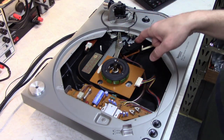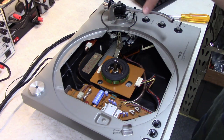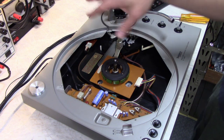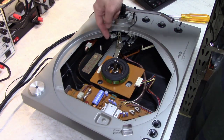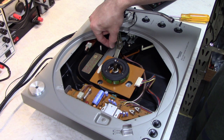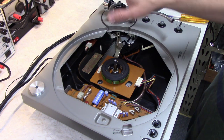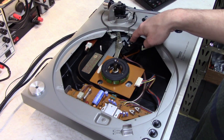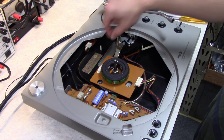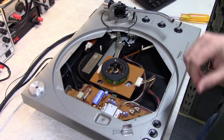This area can get a little gummed up. When I got this turntable it had been completely doused in oil to try to free it up — I had to clean it up, there was oil down in the pan and everything. You don't want to over-oil it. If it feels really stiff, it's worth cleaning the grease out, but you can also just spray a small amount of silicone oil or even a little 3-in-1 oil to help free it up, or better yet take it apart, clean it all up, re-grease it, and put it back together.